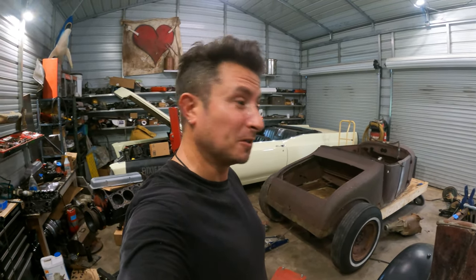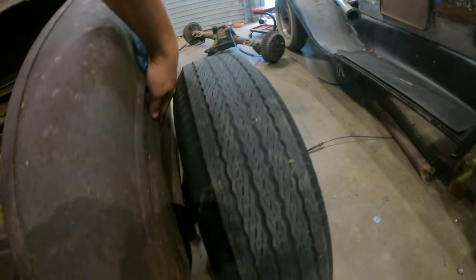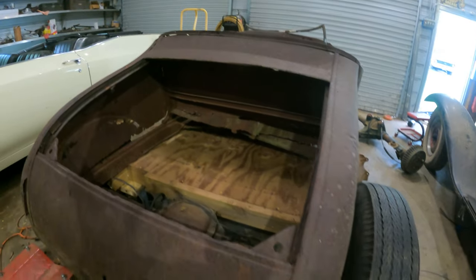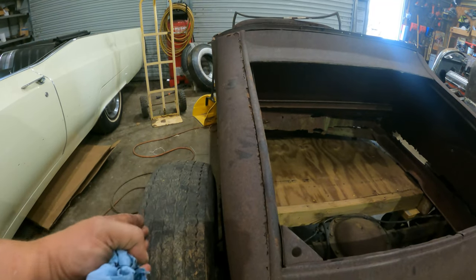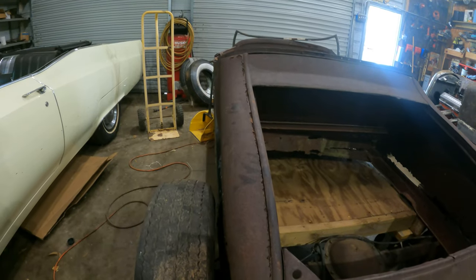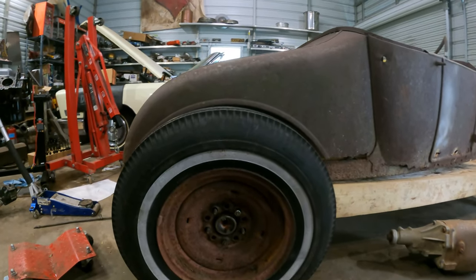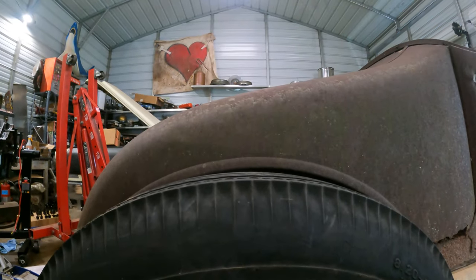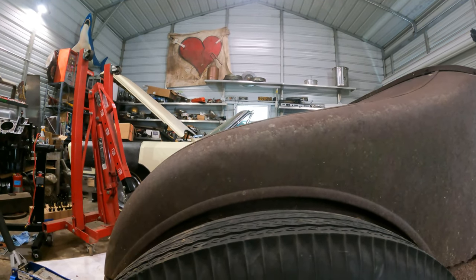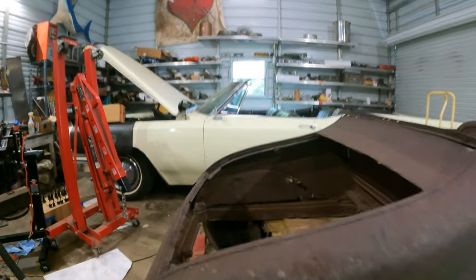I guess this is exactly where I am, and I'm smiling. So — S10 rear end — the wheel wells are a little floppy so we've got some room, but you can see on the sub rails there is clearance. I didn't even bother to center it because we are pretty close. I'd like to get them out just a fuzz more so there's room for them to rock and roll over bumps without hitting the side of the body. But it is really fun to see that an 8.20-15 looks like it was made for that wheel well. I'm trying to give you all the perspectives — that's where I want it sitting when the suspension is loaded.